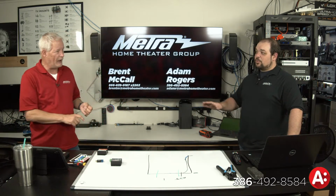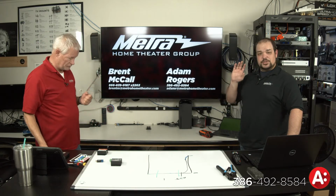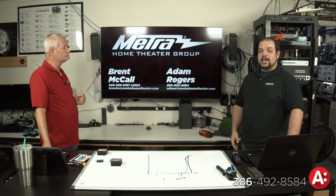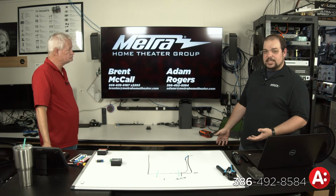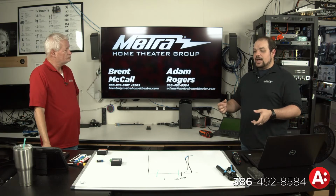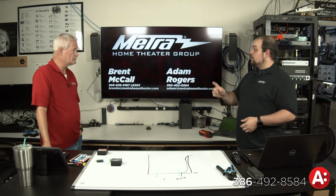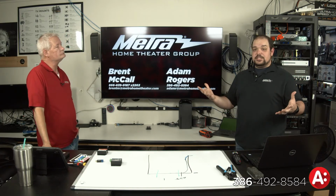Same process that you go through on the television, do the same thing at the AVR. Check your inputs. Check the output. Again, if you have something like a Murideo testing kit or the Fox and Hound, use the analyzer. Put the analyzer on the output of the AVR. Check and see if you have a picture.